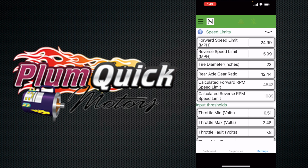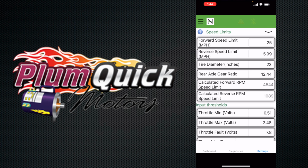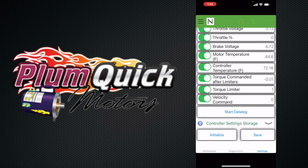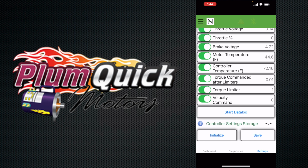Now, if you wanted to change the forward speed limit, you would just tap it, delete it, put your number in there, hit done. You're gonna have to accept this right here. You're gonna have to come all the way to the very bottom and hit save. Save changes, yes. Once it's done doing its thing, we're gonna turn the golf cart off and back on and do a power cycle. That way when you go to your dashboard and you go back to your settings, it's still changed as well.